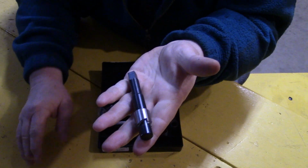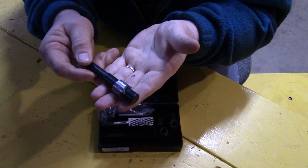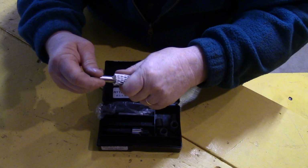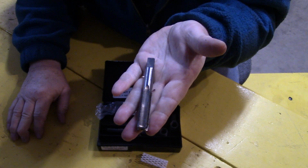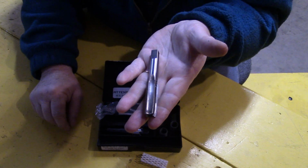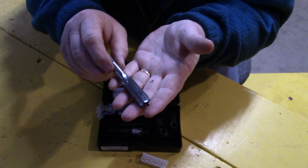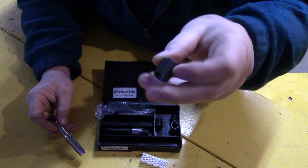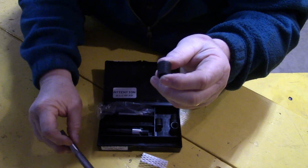And this is a very sharp cutter as well, and that cut very quickly. Of course, I was milling aluminum, so that's probably a reason, or maybe more of a reason, why it cut so easily and quickly, but this cut it very nice and neat. So after you cut that shoulder, then you take the tap, and the tap here, in my particular case, is an M14 by 1.5 tap, and this is a very good quality tap as well, very sharp, cuts the threads very, very nice. Did a really nice job cutting the threads. I only wish I had gotten some video of when we did this, because it looked very, very nice. But the size of this thread matches the threaded insert that you're going to insert. So this thread here on the outside is what this tap is tapping the hole to.